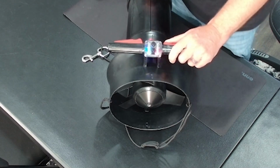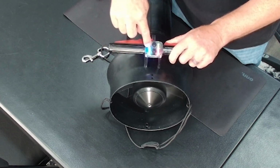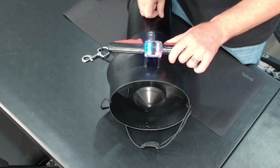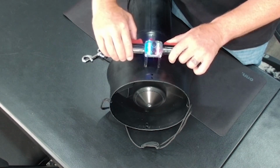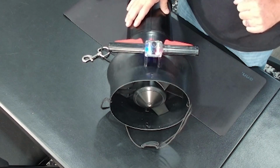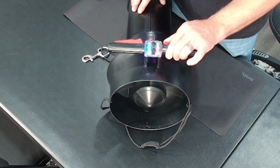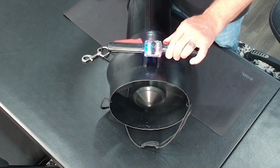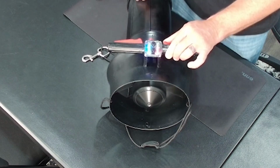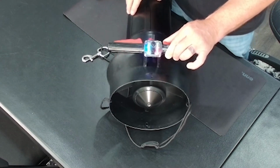Tech mode means 1 trigger, scooter goes. If I'm on trigger, I'm all set in my settings to default to speed 4. If I double tap the other trigger, I automatically go to 9 or highest speed. Double tap the other trigger again, I automatically go to the speed I was set to. Now, if I up my speed, now I'm on 5 or 6, you can hear it kind of wind up a little bit. It does take some time to accelerate, which the boys like. So it's not a really quick snap and jerky. So all the way up to 9, double tap goes all the way down again.